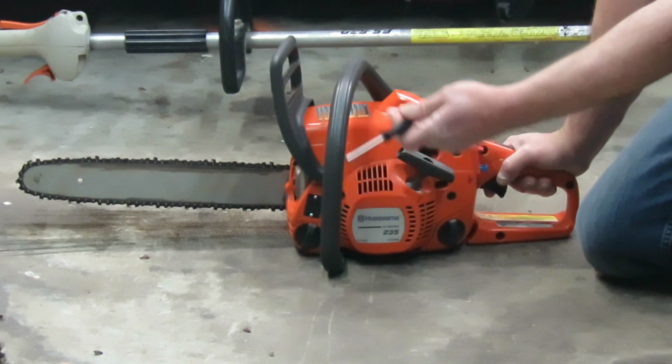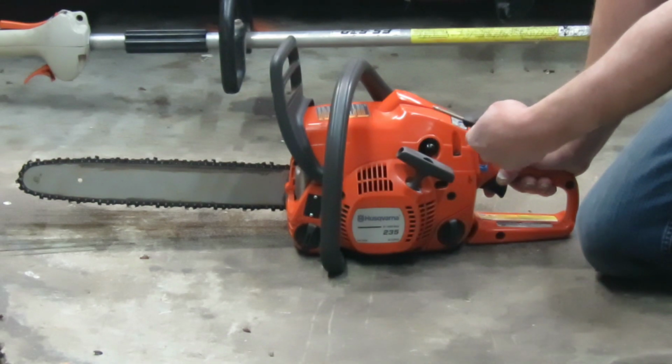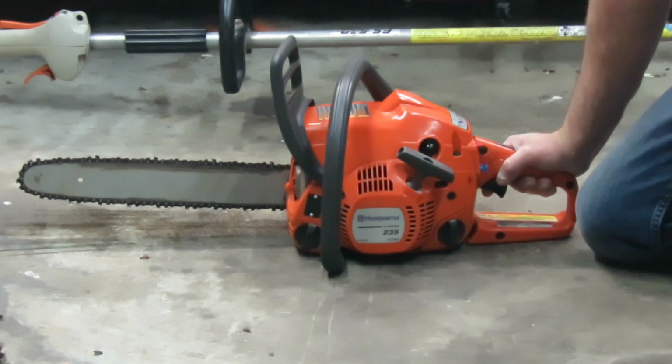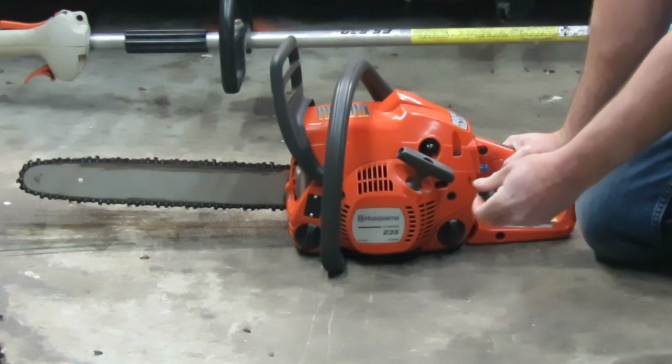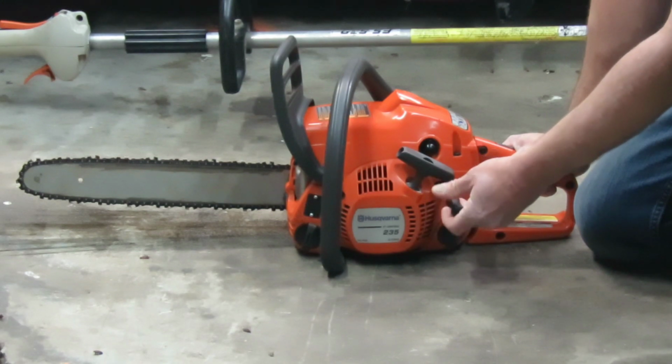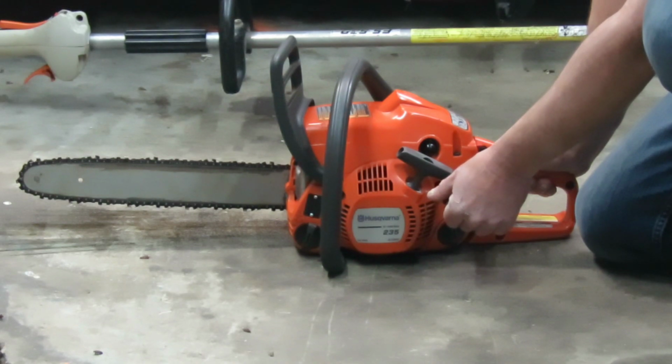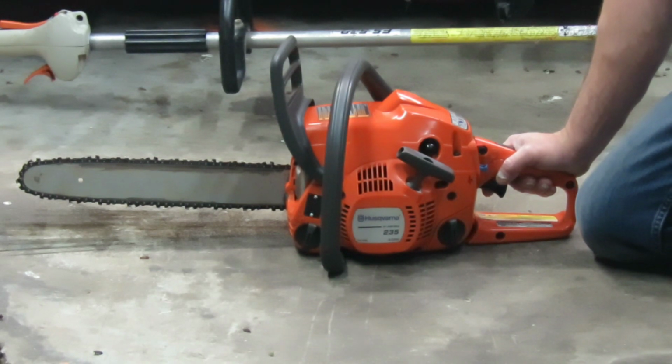I can't really talk to you. I have to yell, or think I do, over the saw. I may be yelling at you through the camera. I don't know. But I'm going to start it back up and put this on the high speed screw, and I'm going to adjust it up, down, up, down, so you can hear that flutter in that exhaust. And as long as you can hear that flutter in the exhaust, you should be safe. You may want to back it off just a little bit more.